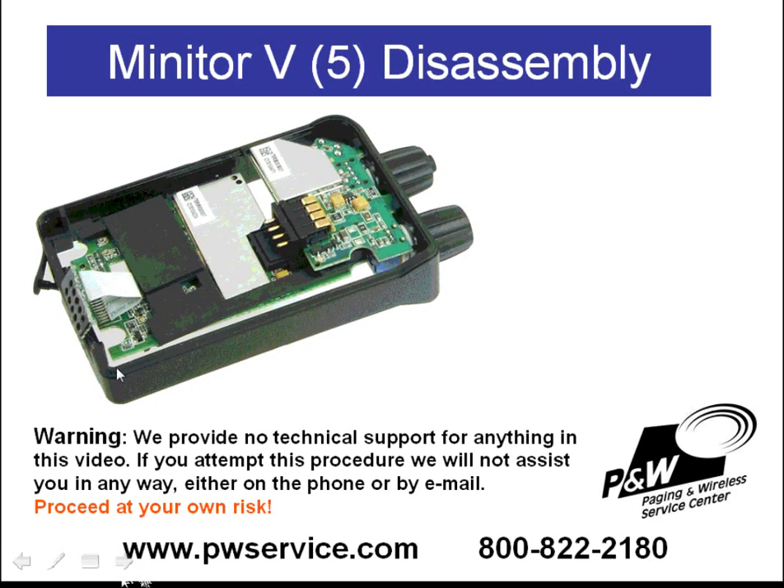Once you remove the adhesive across the charging contacts, you can push the contacts out. It's easiest to do on the other side of the board — just push this up. You'll want to be careful not to touch or damage this ribbon cable, as it is easy to damage or break these ribbon connectors. So be very careful when you do this.